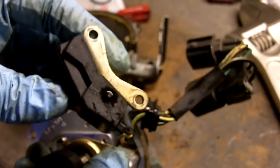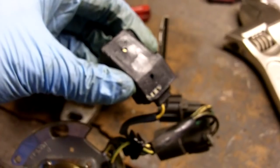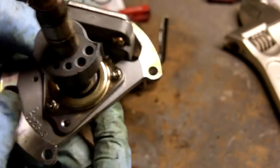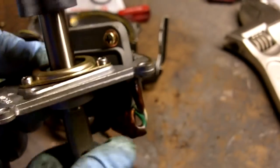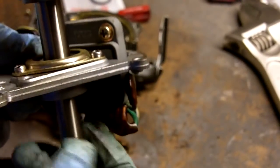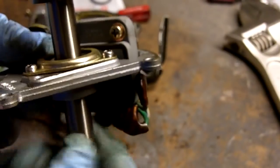This is your igniter right here. This is your cylinder position sensor. And this is just the harness. This is the back here retained by these 3 screws. This is the bearing. Now would be a good time to check your distributor bearing. It should spin freely without making excessive noise and should stop shortly after.